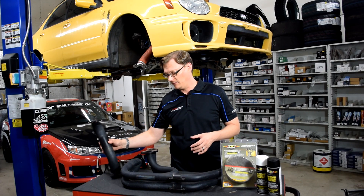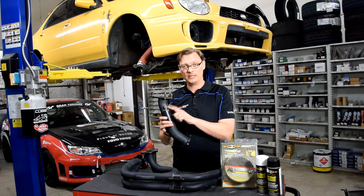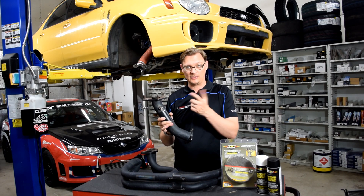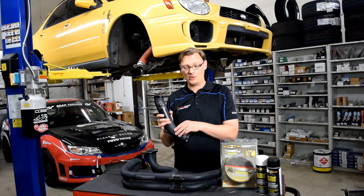Based on that experience, the first tip is: if you have an uppipe with a bung and you put a plug in it, go to any reasonable measure to lock it off so there's zero chance it's going to come out. What we've done here is put some tack welds on it, so this thing should be going nowhere now.